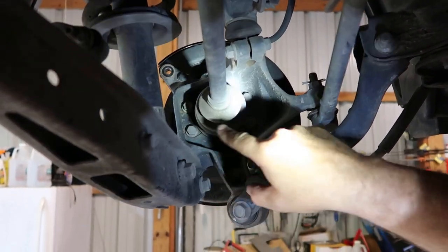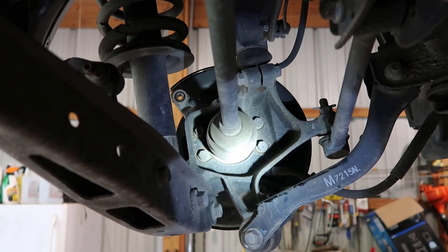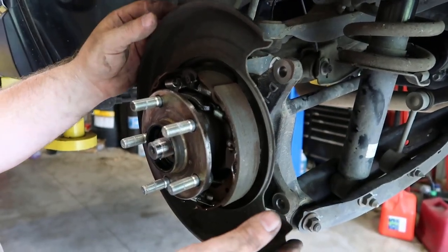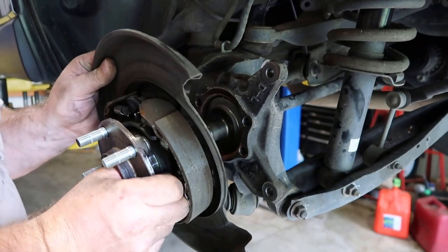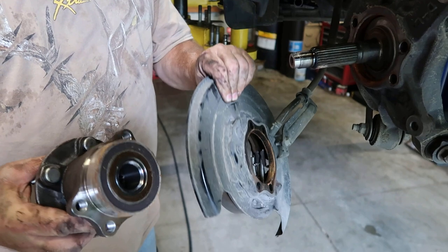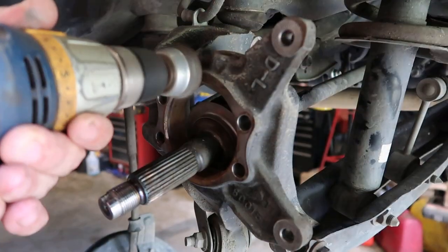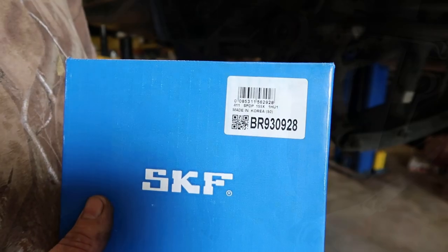On the backside of this hub assembly you're gonna have four bolts right here — one, two, three, four. You're gonna take them four loose; those are 14 millimeter bolts. We got the four bolts out of the back. Now we're fixing to get ready to take this bearing assembly off, and your backing plate right here is going to be coming off with it. All you're gonna do is slide it out, push in on the axle right there, and just pull your hub assembly off. With a little camera magic here, the bearing is gonna come out. I got my wife to hold this backing plate and I just tapped the back side of this bearing — I couldn't hold the bearing and hammer and everything all at the same time.